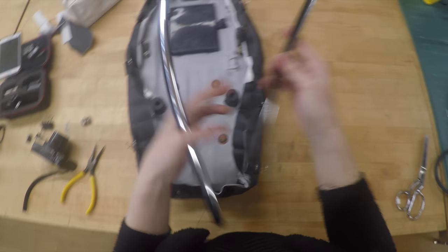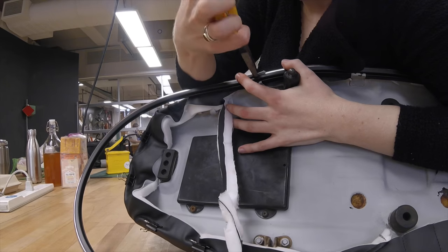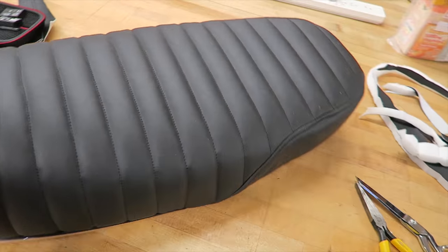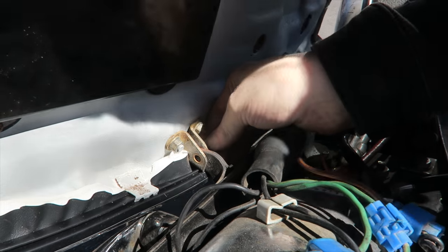I ordered this reproduction chrome plastic trim online — it works by pinching the upholstery to the metal seat pan while the metal clips on the inside of the pan grip into its groove. Swapping the original seat out for the new one was just a matter of two metal pivot pins, each with a washer and cotter pin.